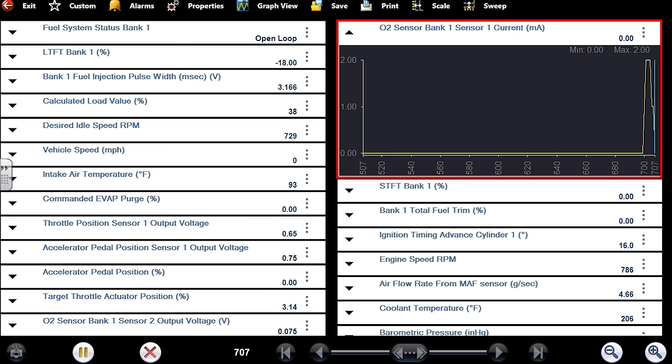Air tube off, there's my MAF — five wire. Let's see if this has a default strategy. Key off, wait five seconds, key on. MAF out of the picture — intake air temp sensor is part of that mass airflow. Calculated load is down to 25%. It doesn't want to idle. Got an open loop fault message. Watch the long-term trim memory when it kicks in — right there, minus 20. Car stalled. I think mass airflow is the issue.